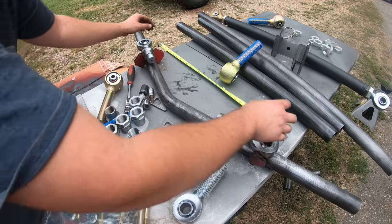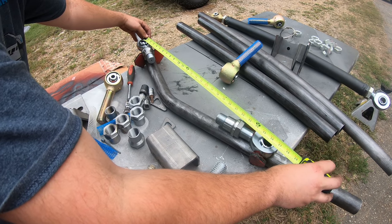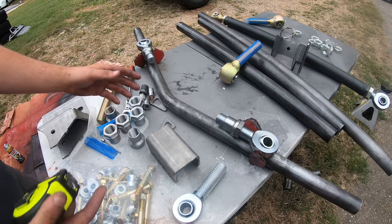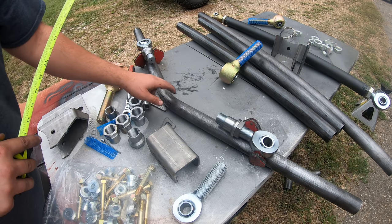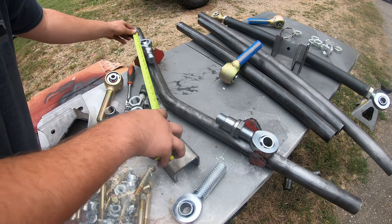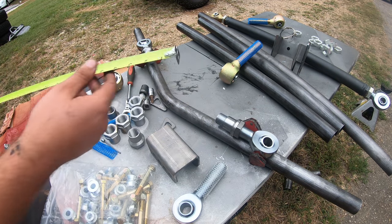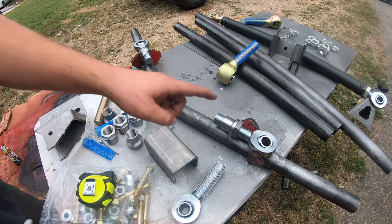I have little magnets holding them up and have it set eye-to-eye at 26 inches. I found the center and made one side almost an inch longer because between the two bolt holes there's a cross member that sits a little forward — we want this bend to be right underneath that cross member. So from the eye to the bend is about 12 and a half inches on one side and about 13 and a half on the other. We mark where the bung is going to weld in and it's time to chop this curved link and weld the bungs in.